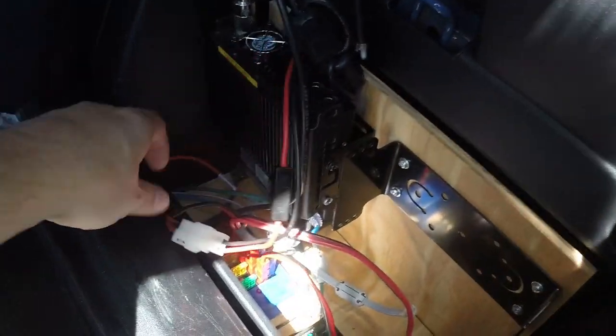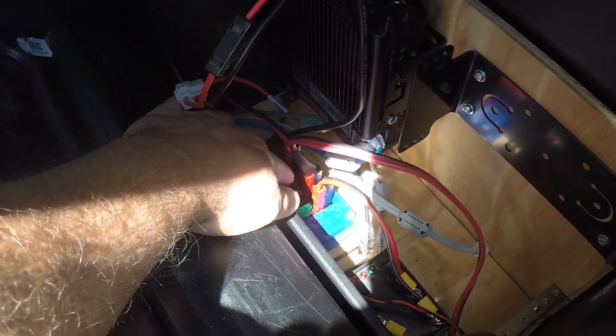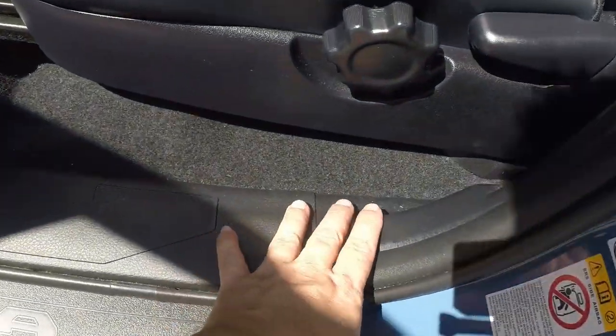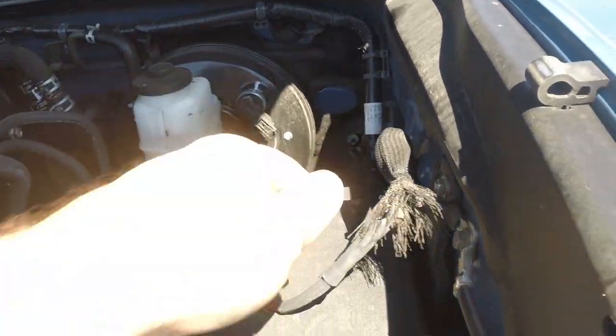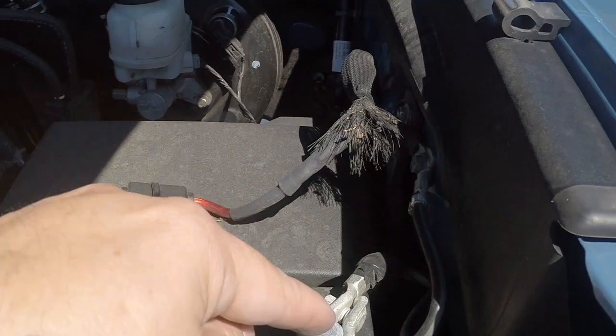Let's talk power. I've got a distribution box and a shutoff that feeds the Anderson PowerPole distribution. This plugs into the 60-amp Anderson PowerPole, and the large cable gets routed underneath the carpet and underneath the plastic — a lot of stuff runs through that section. Power goes underneath and through the firewall. The power comes through a grommet on the driver's side firewall. Power cable comes up with an inline fuse, tied directly to the battery, with the negative going straight to the chassis, which connects to the battery negative.